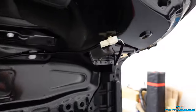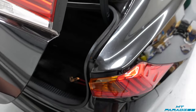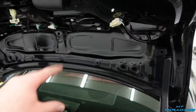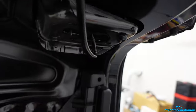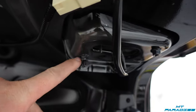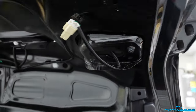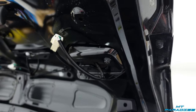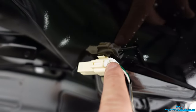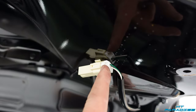Removing the carpet exposes where the tail lights are. Starting with the one on the rear deck lid, open that up. Now that we have the carpet out, go up under here. You'll notice the wires — there's a 10 millimeter nut right there, another one right there, and then two plastic ones on the end. Those four are the ones to take this off. Take off all four of those, and then there's this little connection here — push in the little tab, which looks like a little two-prong fork — push it straight down and you'll be able to unplug it.